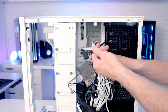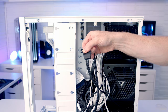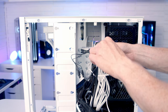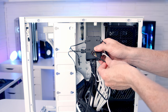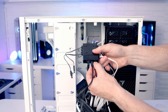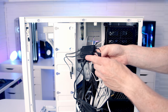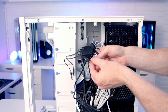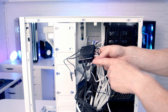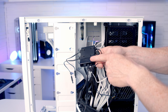Now I want to come to the bottom of the hub. Coming from the bottom we've got a SATA cable, which we need to plug into a SATA cable from our power supply to power the hub. There's space for two additional cables: first is a USB cable — we'll plug it in, and on the other end we've got a USB 2.0 connector to plug into our motherboard. We also need to plug in this double cable which has a four-pin PWM connector and a 3-pin 5-volt ARGB connector — the idea is that if you plug these into the appropriate pins on your motherboard, it gives you motherboard sync for both fan speed control and ARGB effects.